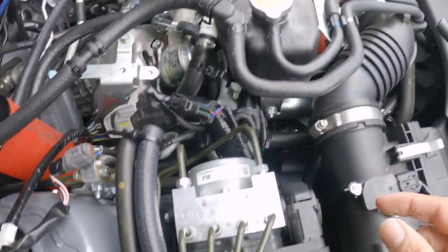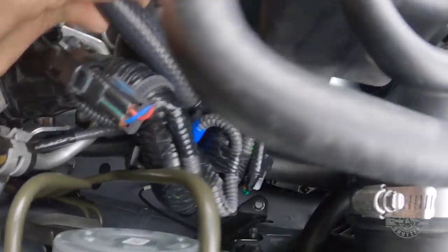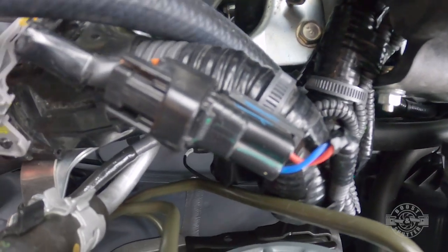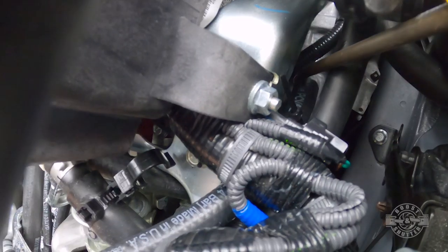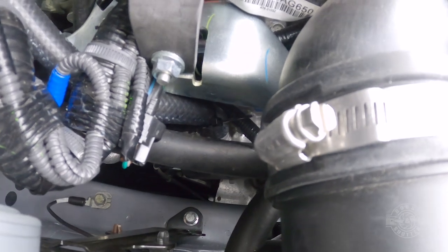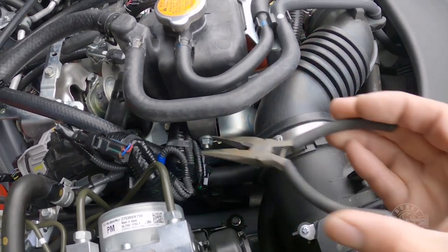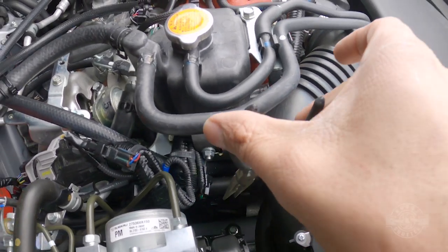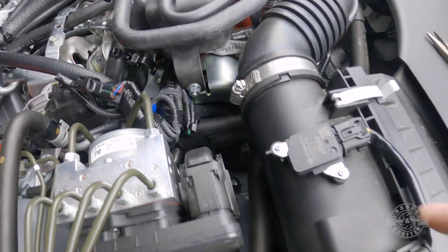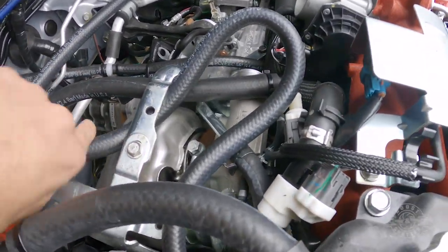For the other side, grab the remainder of the hose just cut and pre-stage a zip tie. Route the end of the hose through here between the harness and the bracket — move stuff around as needed to make room. Then maneuver the hose right onto the barb. Use small needle nose pliers to tighten the zip tie. If you need more room, remove the airbox and that will give you all the room you need.